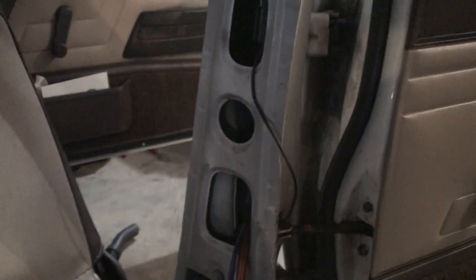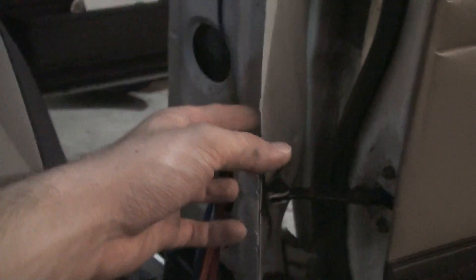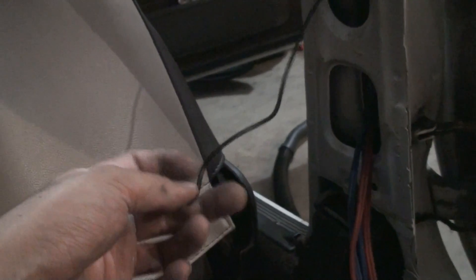All the wires run flat so they could fit through the B pillar and out the bottom — that is literally the only guaranteed way to run those wires in this car, short of going all the way to the A pillar. The speaker cables have to loop back to the rear of the wagon, so the A pillar wouldn't have been long enough anyway. The camera cable is at its full length — I had to cut the head off to fit it through and I'll need to extend it to the front, then put the end back on.